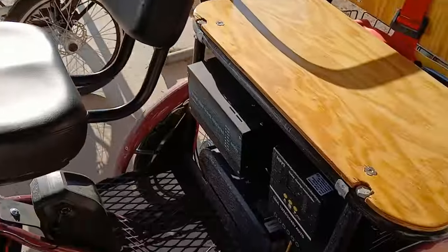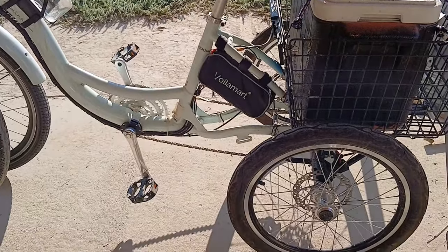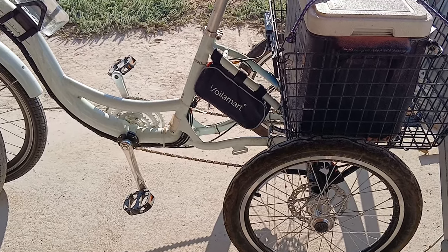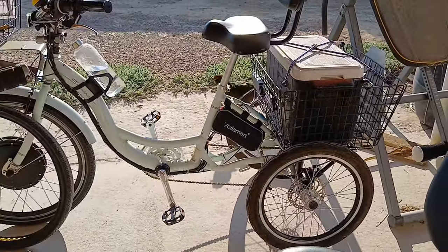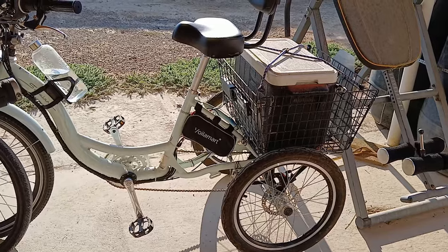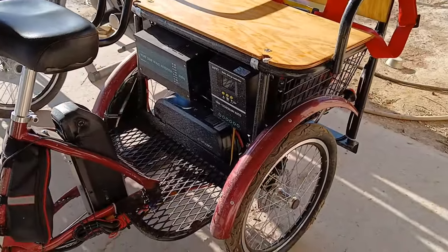My next plan is to take them off the Chariot and put them on the standard tricycle, and take those and check the spokes, Loctite, disassemble them, Loctite them, get everything ready, and then install some really good wire cord stiff tires if I can find them, and really heavy-duty tubes that I can maybe run a little higher air pressure in. And I'm going to put that setup on the Chariot and try that.